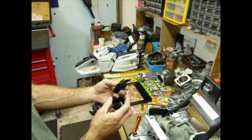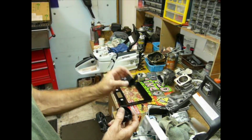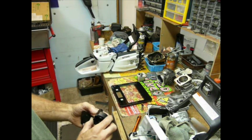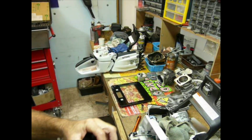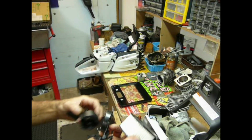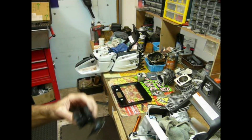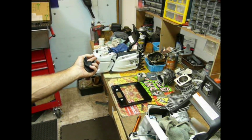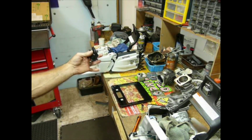I don't know if the patent ran out or somebody's paying somebody for the process to use that concept, but the 462 has that system now. This is actually inside the air cleaner. The baffle system goes inside there, air flows down through and into the carburetor. So pretty lightweight operation. In West Coast trim, it's 13.9 pounds, 15.7 pounds, so it's quite a bit lighter.